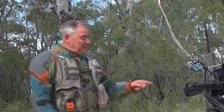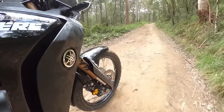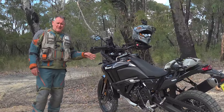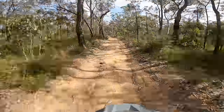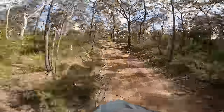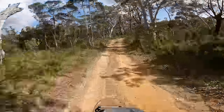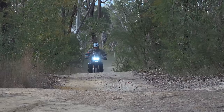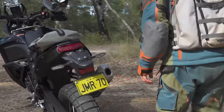See the smile on the face — front suspension is absolutely sorted. I've got to do more and press it harder, but I already know they've nailed that. That's on the standard clicker settings. There are 24 clicker settings on the front for both compression and rebound, plus preload adjustment. My senses already tell me it's about spot-on. The rear — I bottomed it, but it didn't fall through the stroke. Coming back if I kept it on the pipe as I jumped it wouldn't bottom, but I think I can get a bit more from the back just by upping the preload.